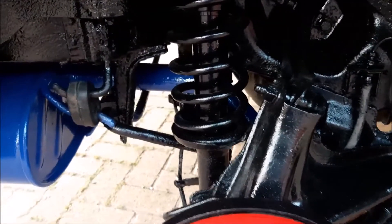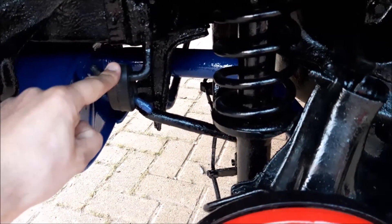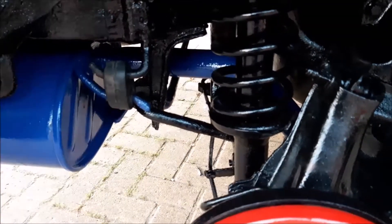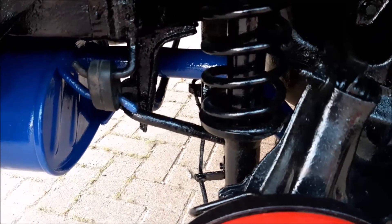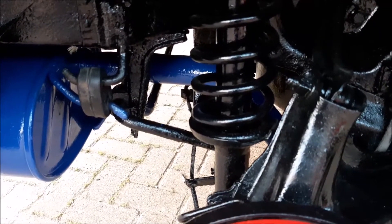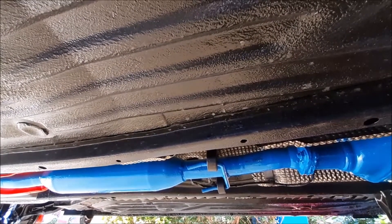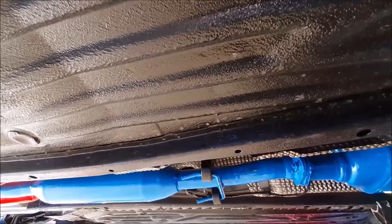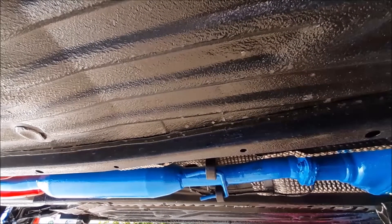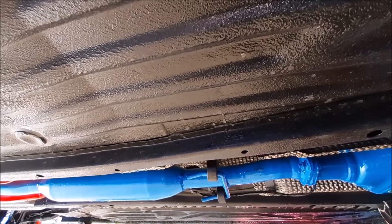From underneath, the exhaust is back all hooked up. We've got new rubber mounting brackets — the right ones this time, found much more easily on eBay. Now it's all mounted up with new rubber mounts, it's just a case of painting the floor. We're currently painting underneath the car — the floor space between each side of the exhausts. We've done most of the suspension and the bottom part of the engine, and now it's just a case of painting it in black hammerite metal paint, which is what the original floor was painted in.